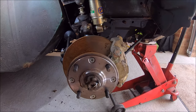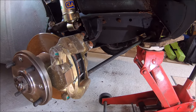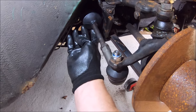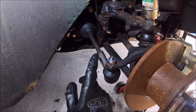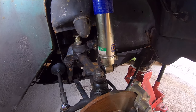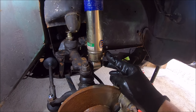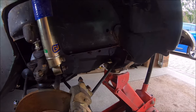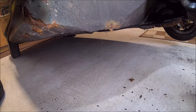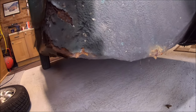That side's done as well — I really didn't plan on getting that stuck in today. On this side I've fitted a new steering rack boot because it was split, fitted a new track rod end, adjusted the high-low, and adjusted the shock absorber as well. Looking around this side it's not too bad, though inside it's not fantastic — I know it needs some welding.